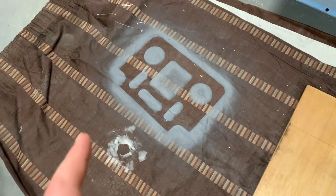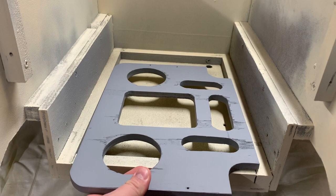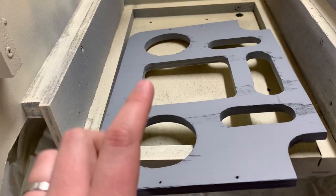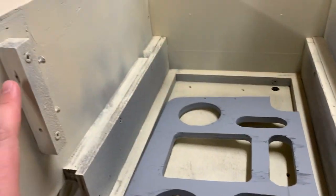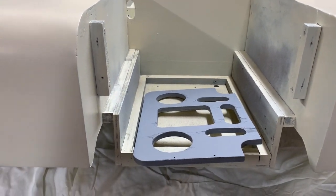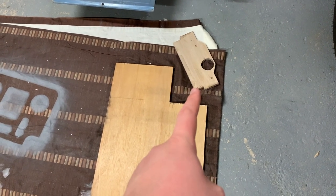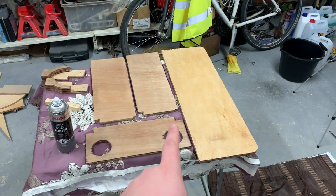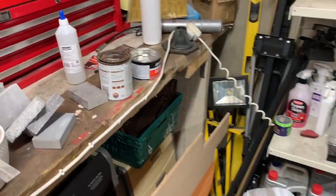Completely unintentionally I've created a very cool outline of a Series One grille — there you go. The glue is dried and this is now sitting in primer. I haven't filled all the little bits here, but this area will be hidden from view and colour coded. I'm reluctant to start filling and sanding again as it's a complicated panel to remake. The seat base is now PVA sealed, as is the back of the seat, the motor closing panel, the rear in-arches, and the two dumb irons — and the grey primer is setting.